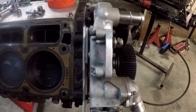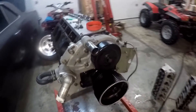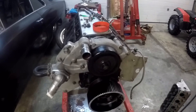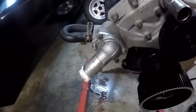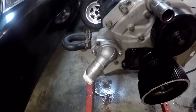I've got pretty much nothing tied up in this short block. One other thing — I don't know what this water pump is off, maybe a newer LS or a Camaro because the outlet positions forward. I made my own thermostat housing — I clocked it my own way, just a piece of flat plate. Anyway, it worked fine.